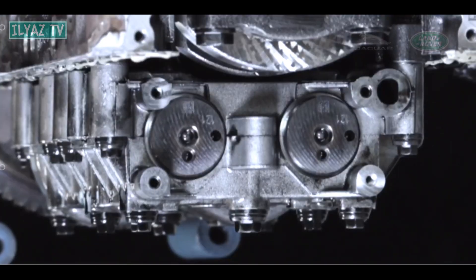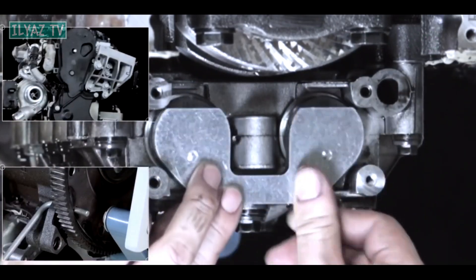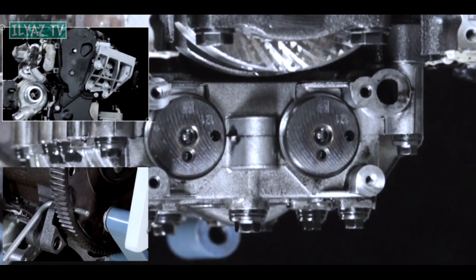The tool number is JLR3031328. If it can be installed correctly, the balancing shafts are in the correct position; otherwise it needs to be fixed. After confirming the correct timing mechanism setting, you can start replacing the timing belt.